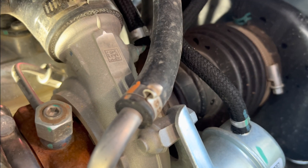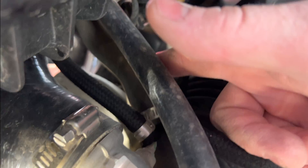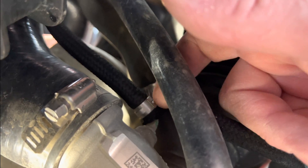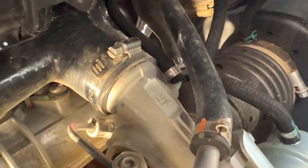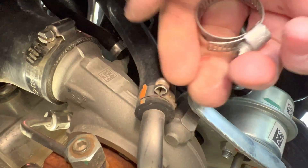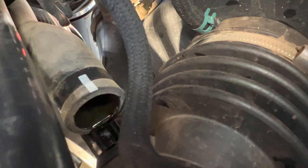Your next step is to come right here at your turbo. You'll see directly behind the turbo is your crankcase vent tube — all that blow-by and oily water mixture comes right here and recycles right back into your turbo. I just wanted to show you that so you could understand what I was talking about. Go ahead and take this hose off. RPM included a cap that we've got to put back over this hole. Get the clamp loose off the crankcase breather line and pull it off. There's your line, and you can see that oily substance that's going to stop going back into your motor.